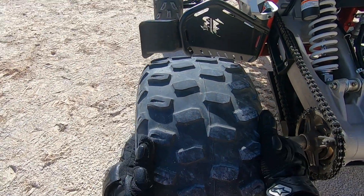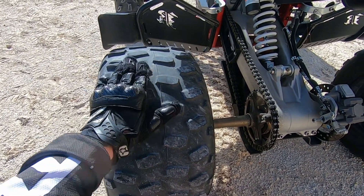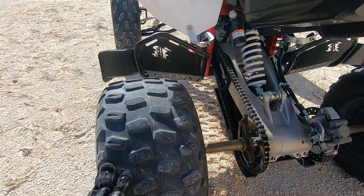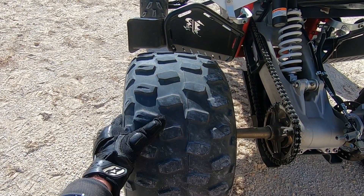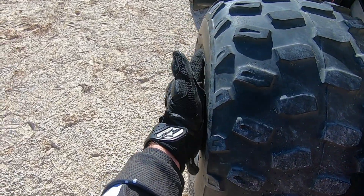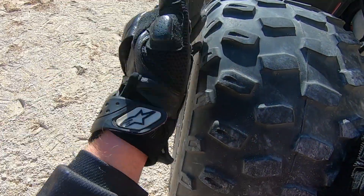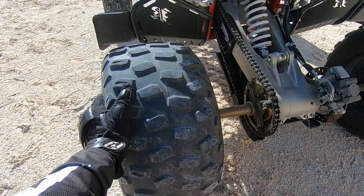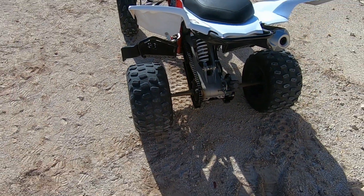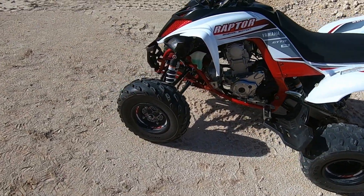Something else: once these tires wear out I'm sticking with the low-profile small tires because I truly believe they give me extra torque compared to a huge tire. But I'm going to switch to YFZ 450 tires — they're about three-quarters of an inch wider on each side. Their sidewall goes straight up and is boxy compared to being curved, giving three inches of extra rubber across the entire axle. I love that low-profile look.